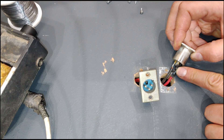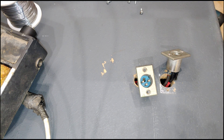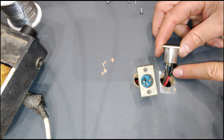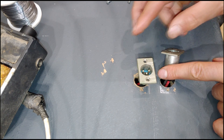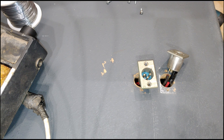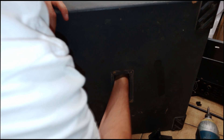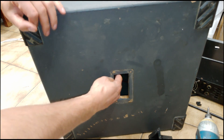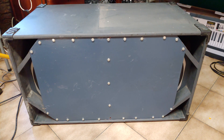What you need to do is de-solder this. I don't feel like opening the whole sub and getting the woofer out, so I'm going to unsolder this carefully so the wire doesn't fall in. You could take long-nose pliers and grab it from the other hole, or do what I've done — I've just removed the handle by unscrewing it, so my hand can get in and feed the wire. Just be careful because if the wire falls in you might have to remove the front or move the woofer to get to it.